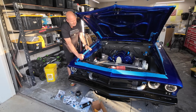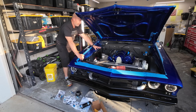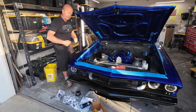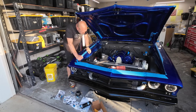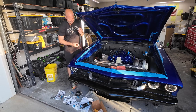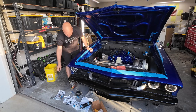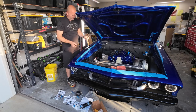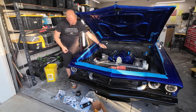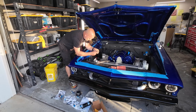The downpipe is completely fabricated and ready to go in — it just needs to be wrapped. I'm gonna have my buddies come over and help wrap it, because on downpipes you've got to hold it while wrapping, and you want it tight, so it's easier with two people holding it and one person wrapping. If you're not running turbos you can just mount the AC compressor up top like normal, but with mine it doesn't work out because I'm using an LQ4 and needed it down in the corner due to the turbos.